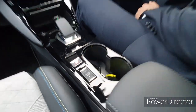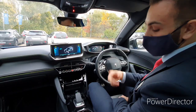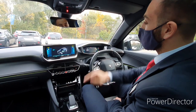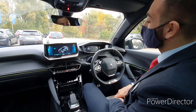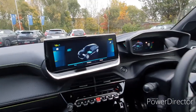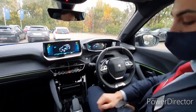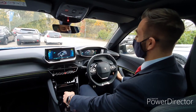You can increase or decrease these effects with the different drive modes. As you go through them, it will change on both screens. The car starts in normal mode every single time you get in it, and then you've got three different settings. There's an eco setting — if you put it into eco mode it physically limits the performance of the car, increases battery life, and decreases some of the thermal capabilities like the air conditioning as well. You'll just see it says ready and eco at the bottom.